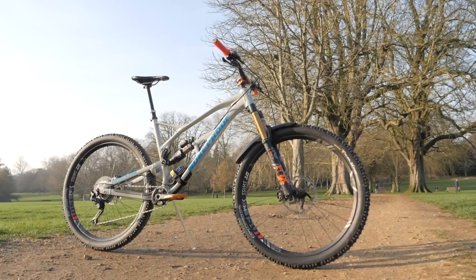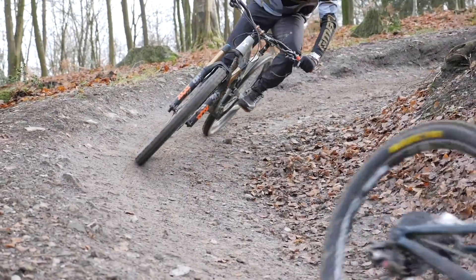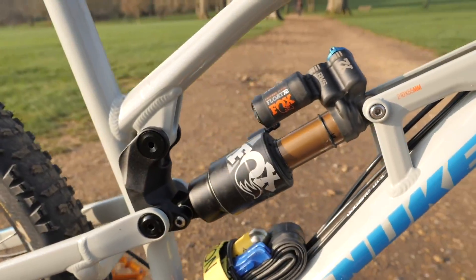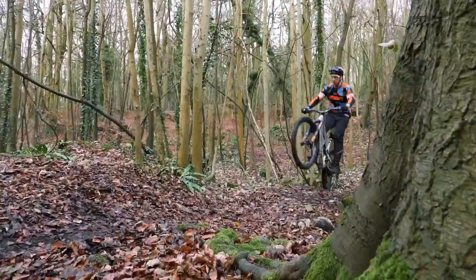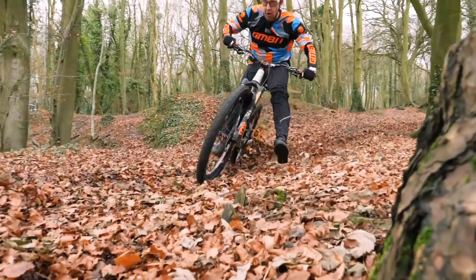It's the other way around with the bigger wheels. The bigger 29er wheels allow a little bit more rollover, a little bit more of a steamroller effect on bumps. If you continue the same travel through, you've suddenly got a bike that feels like an absolute monster, so reducing the travel gives the same or very similar characteristics between the two. The 29er, despite being such a huge bike — and I know because I've got one — it's actually pretty agile, surprisingly so. That's done purely by keeping that travel down, keeping it feeling a bit more stout.